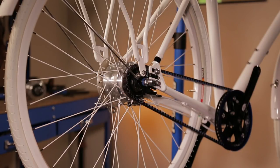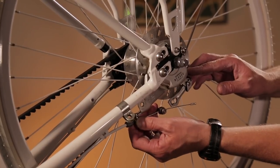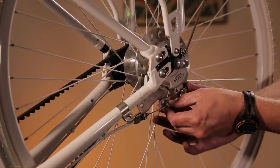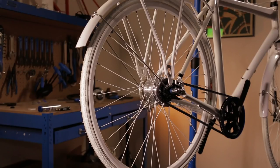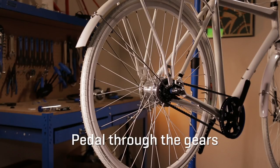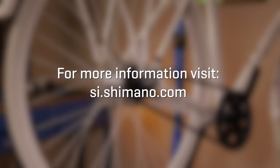Reconnect the hub as demonstrated earlier in this video. Make sure the axle nuts are securely tightened. To reconnect the roller brake, connect the cable into the cam transmission plate and slide the brake arm into the brake arm clip, connecting with the clip screw. With the rear wheel still elevated, pedal through the gears to make sure you are able to shift properly, and test the brakes to ensure proper performance. For specific details regarding the installation, removal, and operation of Shimano components, refer to your Shimano owner's manual, contact your local bike shop, or visit si.shimano.com.